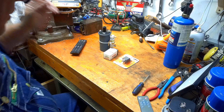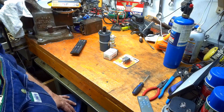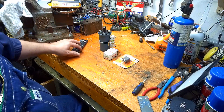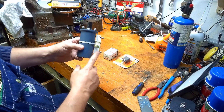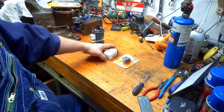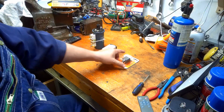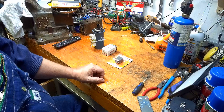Now I'm getting reliable spark. I didn't make a video on that but I will in the future. Right now it's the global pandemic, we're on lockdown, and I need more buzz coils — not going to any engine shows. So I looked up online how to make one and we're going to try to make one today. Amazon just delivered my parts: I already have a ballast resistor attached to a 12-volt coil — this one requires a ballast resistor. I got a condenser, this one is MasterPro 2-2013; any old automotive condenser will work. And I got a 5-pin relay.